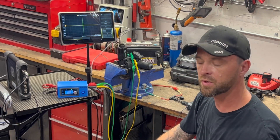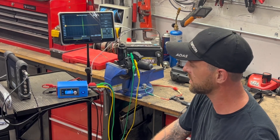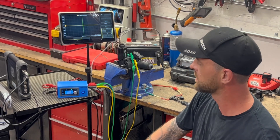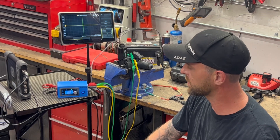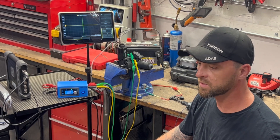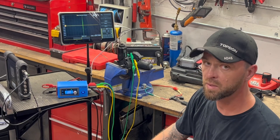It does 0 to 30 volts, so you can select it and then just turn the dial until you get it where you want it. Say it's a 5 volt reference circuit and you think it may be shorted - you just want to put 5 volts on that circuit, you select 5 volts and you're good to go. Or what if it's an 8 volt circuit? I see these other 5 volt power sources and that's great for a 5 volt circuit, but a lot of these vehicles use like an 8 volt reference or a 10 volt reference, whatever the manufacturer decides. This being 0 to 30 volts, it can pretty much handle it all.